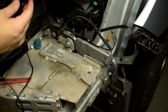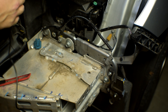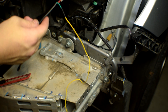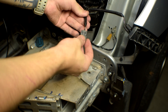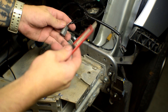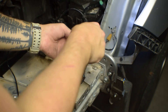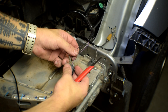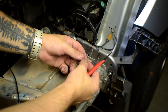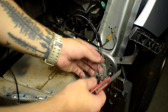Let's work on wiring everything up. We're going to take our main power here and set that out of the way for now. We'll get all the wires prepped — we have our smaller side on this side and the longer cord going the other way. We have the turn signal here, so we're going to remove the existing electrical tape to expose the wires. We'll be using the white wire and the black wire — white is positive, black is negative. For the turn signal, we're just using the white as positive, and that's where the yellow wire is going to connect. Let's go ahead and strip these wires.